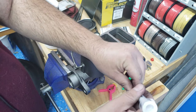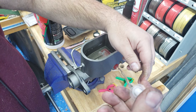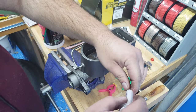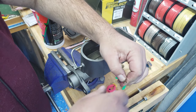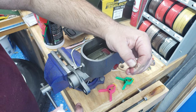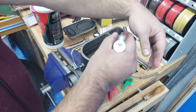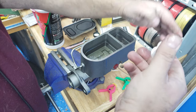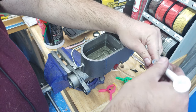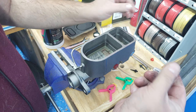Okay, so then I think that this side, well, there's a little bit of air still coming out of there. Let me do one more. And see, I'm actually pushing some air in because when I let the syringe go, come out of the tube here, some air actually comes back into there. So I'm gonna actually bleed this the opposite direction too by pushing in on the cylinder, but I will do that after I get most of the air out this way. Now that didn't take nearly as long on that side. Okay, that's much smaller.